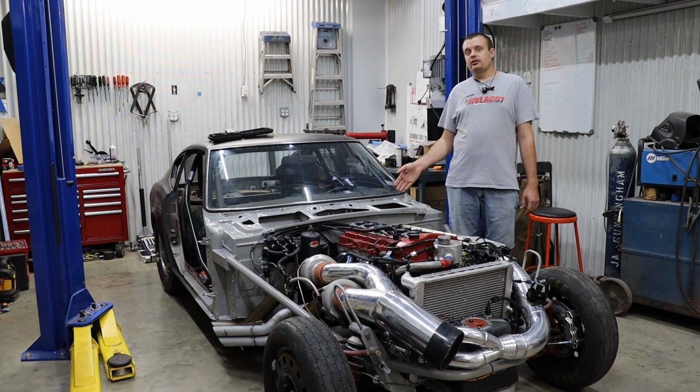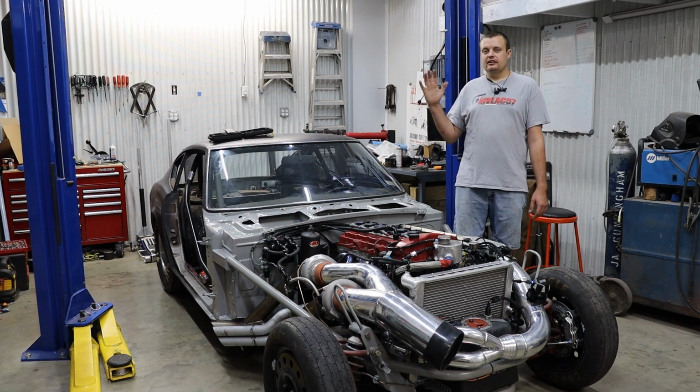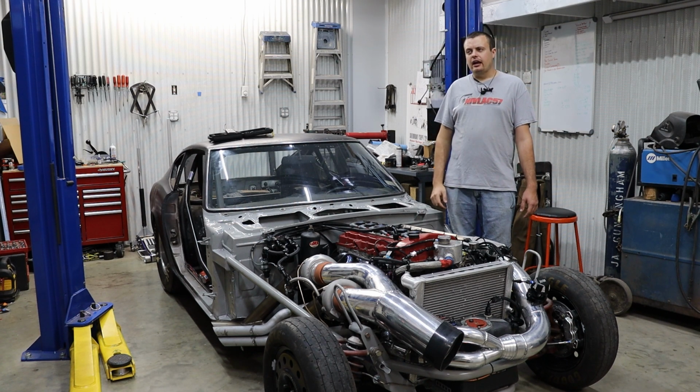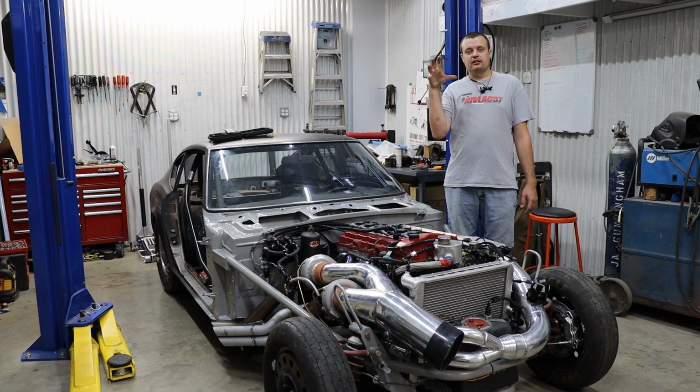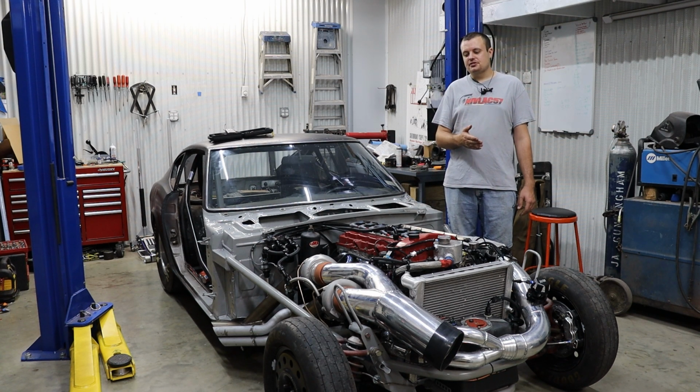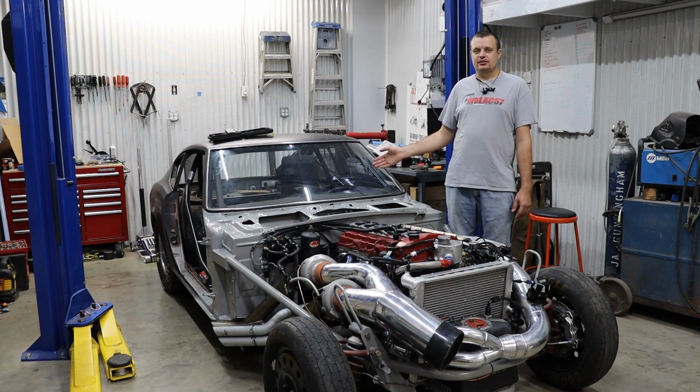Unfortunately, with the failure of the torque converter, it probably generated quite a bit of thrust on the engine, and my guess is the thrust bearing is totally shot. Also, it probably shifted the torque converter a little bit, and my guess is the pump in the transmission is also shot. This really sucks because now we have an engine that's hurt and a transmission that's hurt.